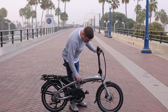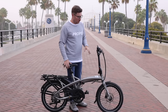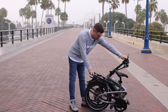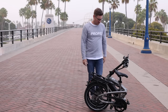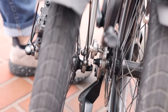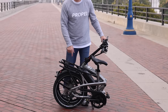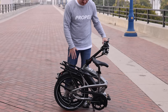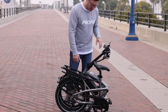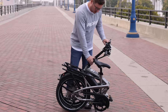The next step is to actually fold the bike. Before folding it, put the kickstand up to get that out of the way. Then push this little safety lever forward and open up the latch. When you go to fold it, you're going to actually rotate the bike just like so, and then drop it down. There are little feet on the bottom of the frame, so it's well supported in this position. What you want to look for is a magnetic closure by the rear wheel — this locks it in place. There is some adjustment to that magnetic closure, and if it's not clamping correctly, that may need to be adjusted.